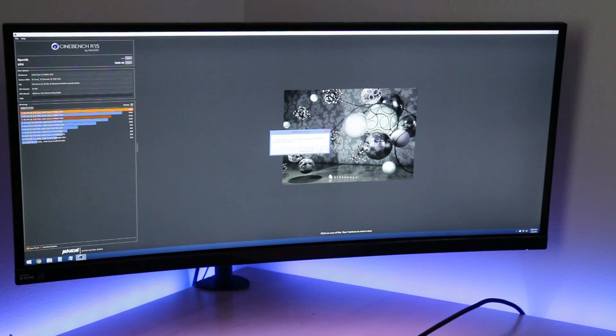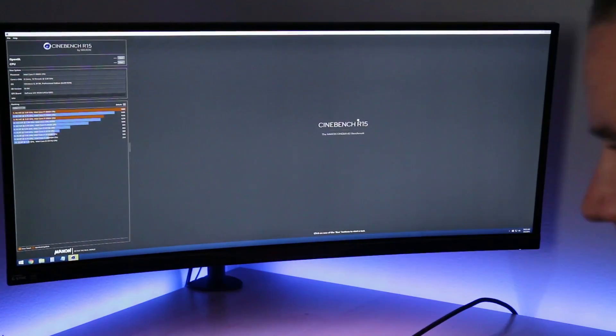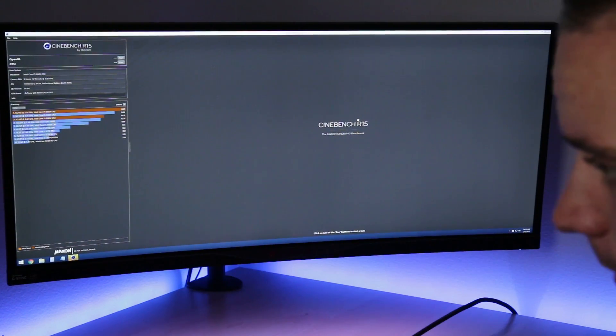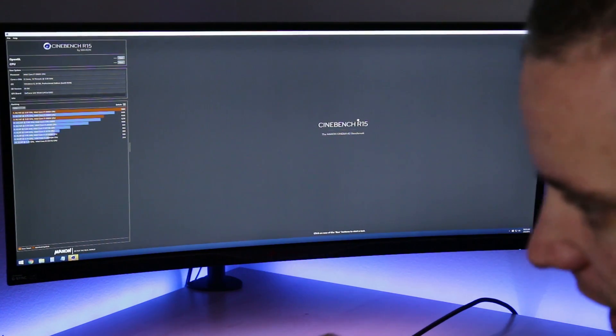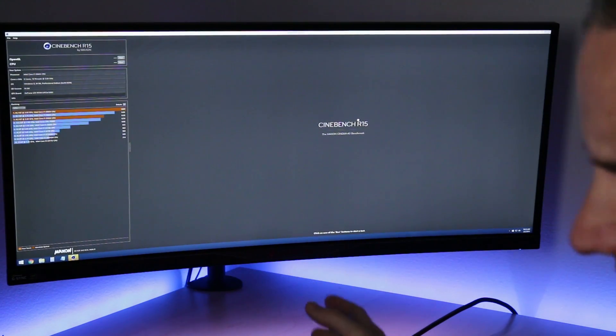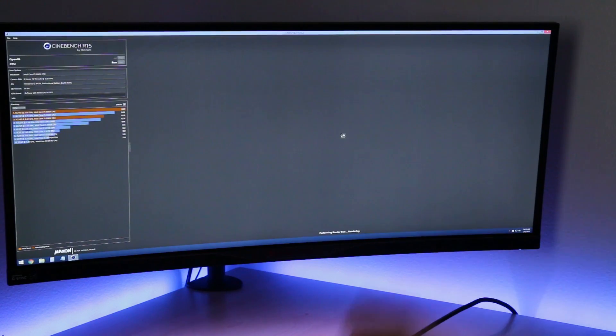The next one is going to take a little bit of time before we are able to actually get the overclock stable. I have to do my max overclock testing, and then I'll come back and show you how far we actually got. So enough time and tinkering has gone by where I have settled on a 4.5 gigahertz overclock on my 5960X — that's actually a 1.5 gigahertz overclock above the base clock. I could get 4.6 all day long on my EVGA X99 Classified board, but for some reason on the Gigabyte board I cannot get 4.6 gigahertz stable. I've also settled on 2666 megahertz on the memory — you typically cannot get the max memory XMP profile speeds while overclocking the CPU as far as it can go. It's a bit of a trade-off, but I'd rather have faster CPU than faster RAM.